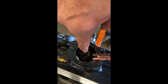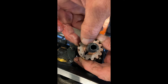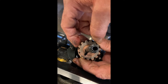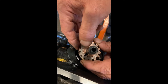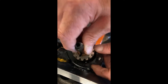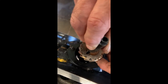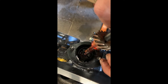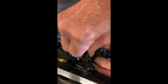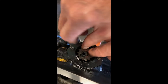This slot drives the oil pump down there. When you look at the gear, the slots are offset - one side is larger than the other. This side is larger, and this has to be to the back of the motor. According to the book, with the timing marks lined up, we want the slot to drop in vertically - in this position. I tried to line up the oil pump like that. I'll explain why I'm putting this in basically a tooth off - it's going to turn when it hits the cam. I think that's all the way down.